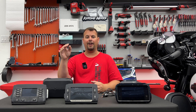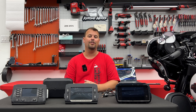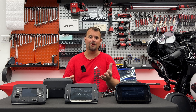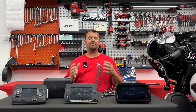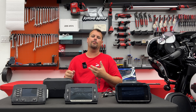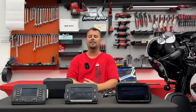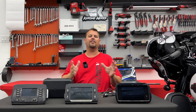I'll show you which flash names are actually just a factory flash with a different label — because whether it says Wild Boar, Volunteer Audio, or any of these many companies, all of those flashes equate to a factory Harley flash that the Harley dealer can't do. We're also going to go over which flash is best for you. Then the fourth video in this series — we're going to take about two weeks to get all of these up — is going to cover how to download the software, the requirements for the Techno Research tool. You need a PC running Windows 7 or newer with internet access. If you have a Windows-based laptop with internet, you're good. We'll show you how to download the software, connect your tool to your bike, and how to do that flash. It's a very simple process, but I want to break it down in its own video.